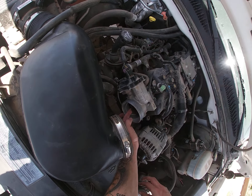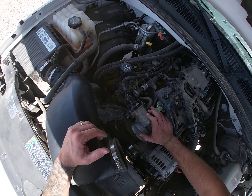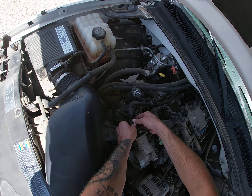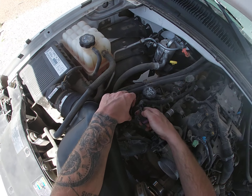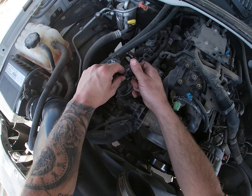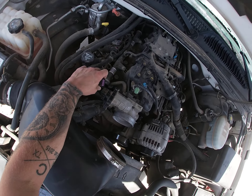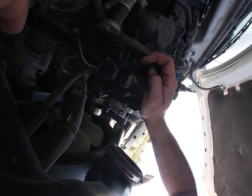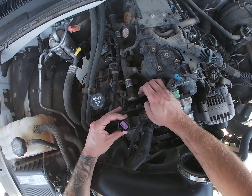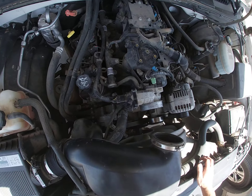Can't really see too good in there just because of the angle — I've got you all on the GoPro 7 on top of my head. But basically what I did for this fix was take your connection right here, wiggle it off, and look on the inside. Make sure your pins are good, nothing's burnt, nothing's crazy. Don't tug too hard — make sure all your wires are properly seated. Another video out there was fixed this way. Make sure all your connections are good, not burnt. And all I did, literally, because everything looked good, took this wire harness, pulled it, checked it, reinstalled it, and it did it for me.